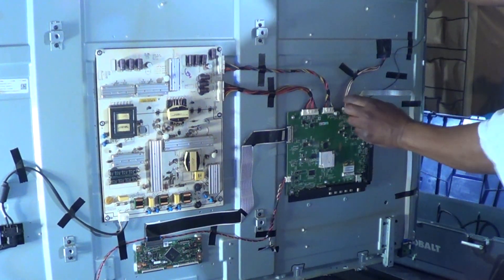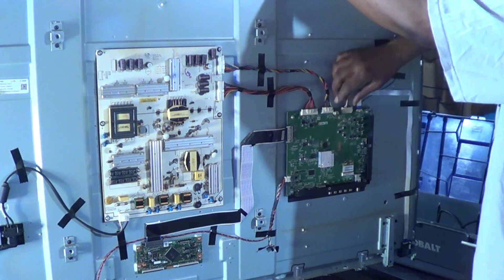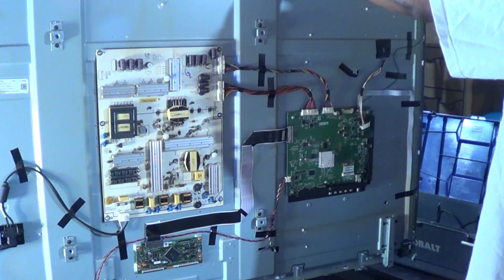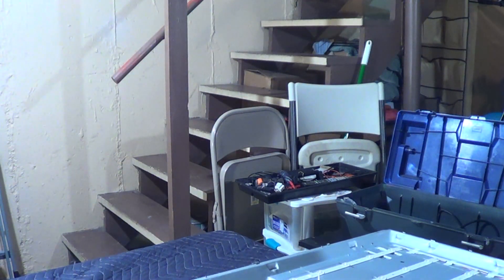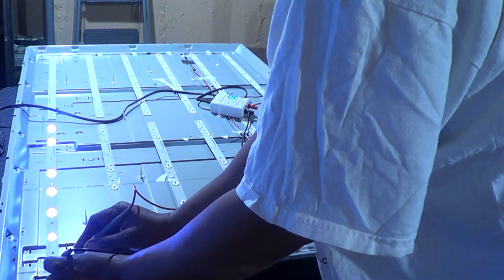The actual power connector for the LEDs is on the main board instead of the power supply. Unfortunately, on this TV we have to disconnect that plug in order for the LEDs to light up with our LED checker, because evidently the circuit has some type of interference with it. I just want to make this video for you techies out there who have had this problem before.